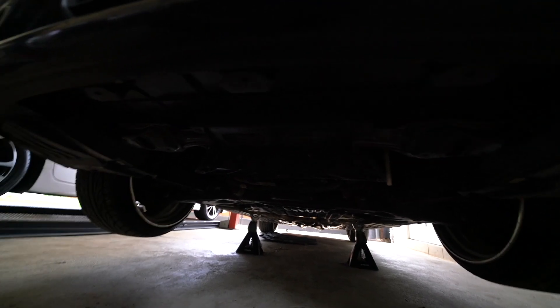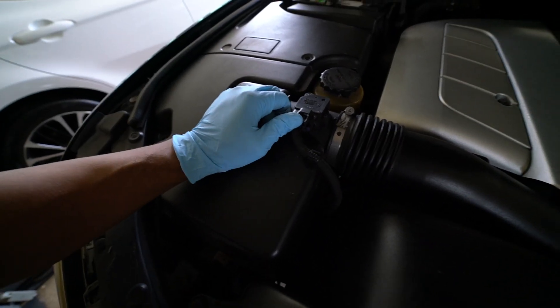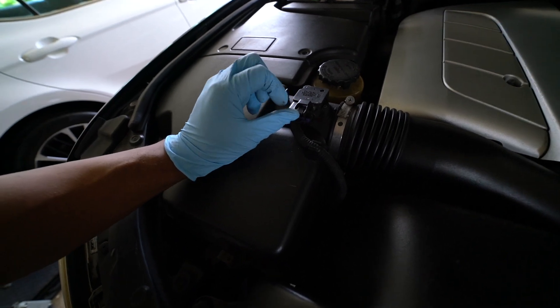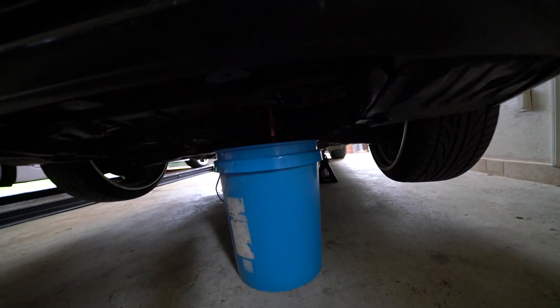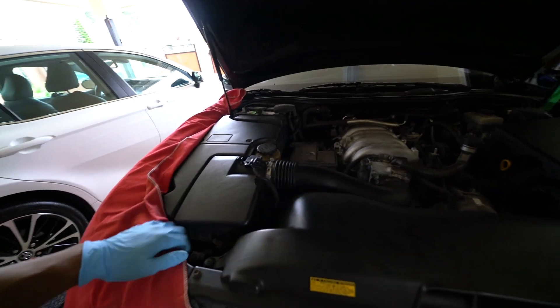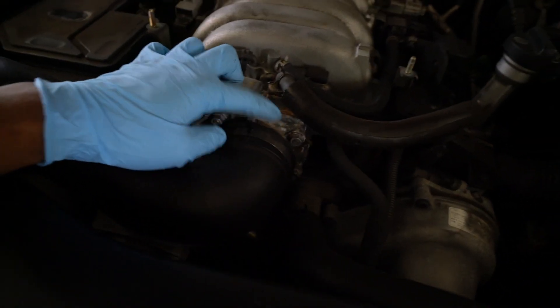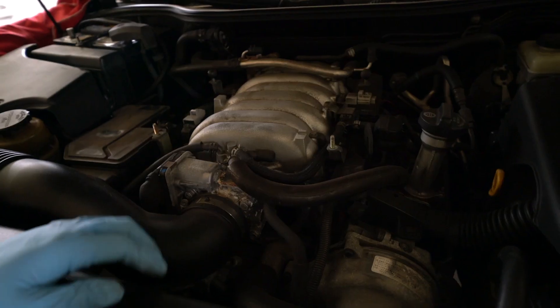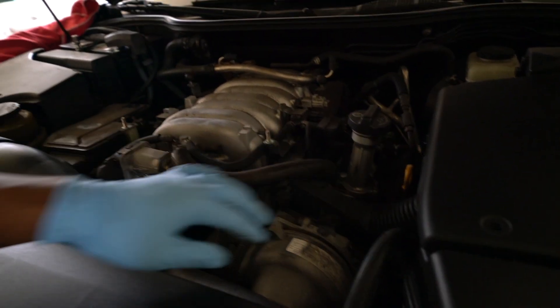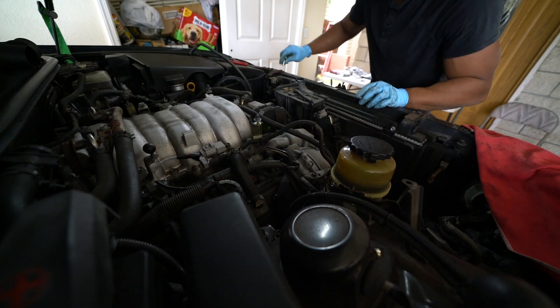It's pretty dark but we got the undertray out. When you're taking out connectors, be careful because they're old and brittle — this one right here looks broken already, so you don't want to snap it. We're draining the coolant, got the cover off, taking out the intakes. There's some residue right here so something's leaking around here. These EVAP hoses usually tend to crack — you can just replace them with new hoses.